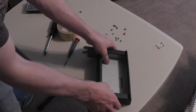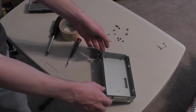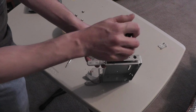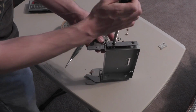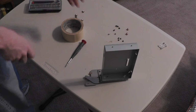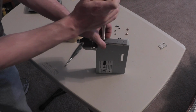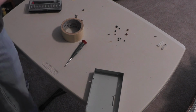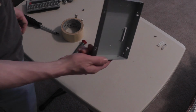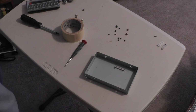With the screws removed, the plastic frame can now be removed. With the frame removed, you can now access the 4 screws around the outside of the screen box. Now all that remains are 2 screws along the top and bottom, holding the screen inside. If your plans include mounting a phone or a GPS inside this box, I recommend cutting almost the entire back off, as well as a large portion of the top to allow GPS signals to reach the device.